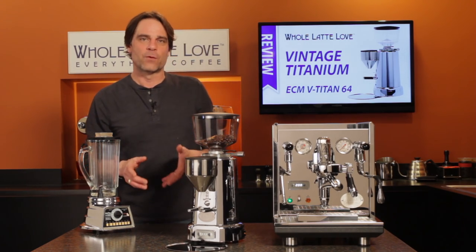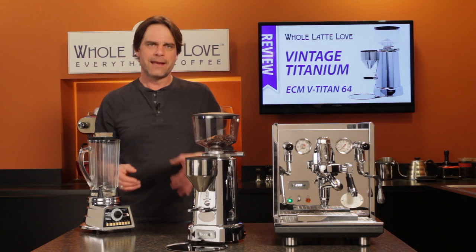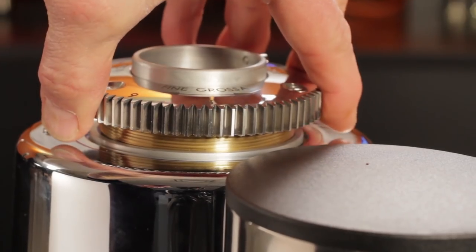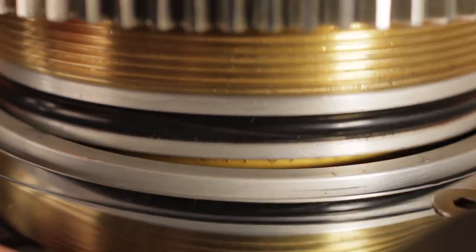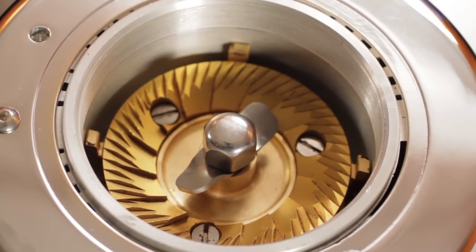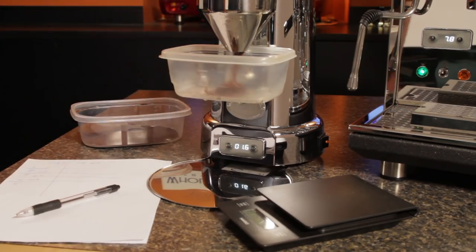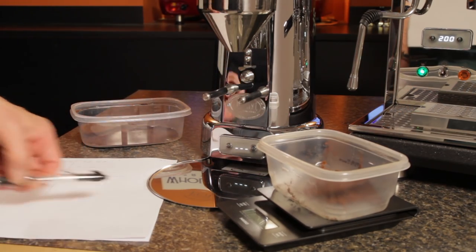Because the worm gear can turn the collar but the collar cannot turn the gear, your grind setting is always locked into place until you make a change. One thing I always look for in a grinder is how well the grinding chamber is sealed from the threads of the adjustment collar — a poor seal allows coffee to gum up the threads, making adjustment difficult. On the Titan, there's an O-ring which seals the grinding chamber so coffee stays out of the threads. Inside the grinding chamber, a propeller of sorts helps assure a consistent flow of beans to the burrs, and that consistent flow results in consistent dosed weights when doing timed grinding.